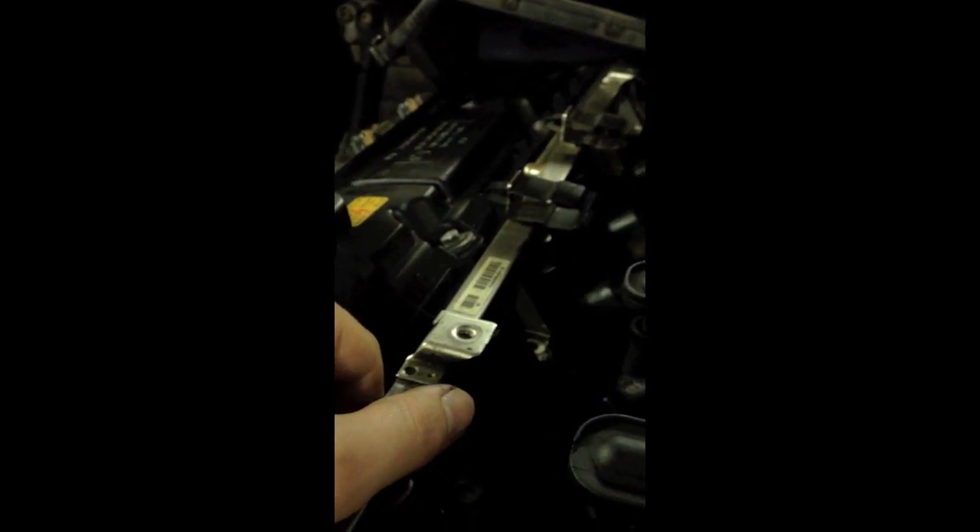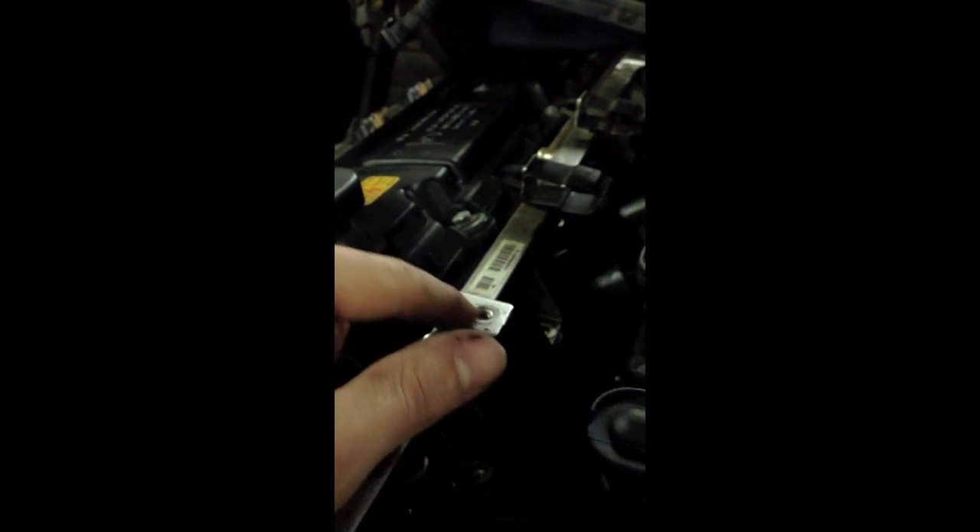This also helps your vacuum pressure, because when these things are leaking, air is getting inside and the engine doesn't know that extra air is getting in through the O-rings of the fuel injectors — and that causes problems. I think it makes the banks run lean, maybe rich, probably lean.